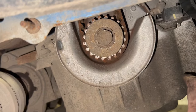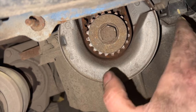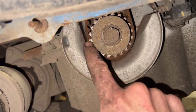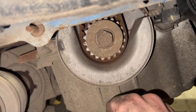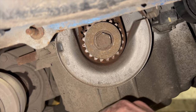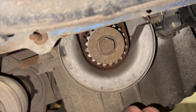As mentioned, this pulley has a keyway so we don't strictly need the timing pin tool — there's a timing mark on the pulley that will show where it sets. You can simply paint mark it as a gauge. But for anyone doing this on a DCI with a floating pulley, putting the timing tool in means you definitely can't go wrong. If you're unsure whether it has a floating pulley, just use the tool to be safe.